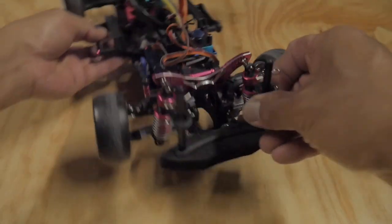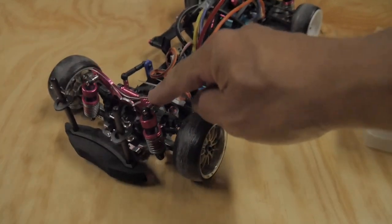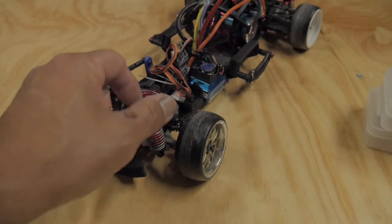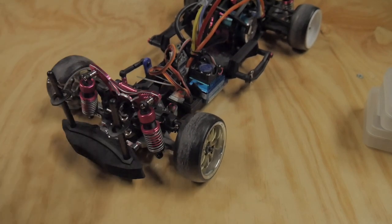And then for the front, Mikuni springs again with different softness. One of the other things I'm going to have to do is take these shocks apart completely and change the fluid. These are the stock fluid that the kit comes with, and I think it might be a little bit too thick, so I'll probably use a lighter weight. I'll have to double check based on my D3 setup, since that's a pretty high counter steer I'm running.